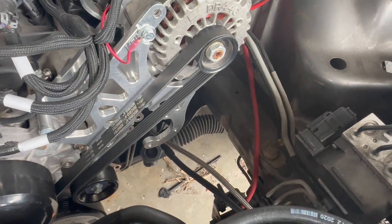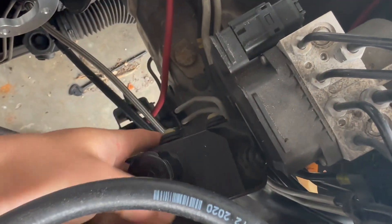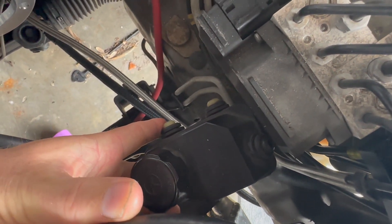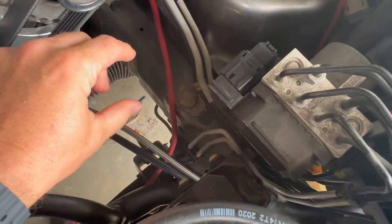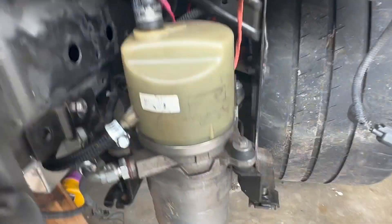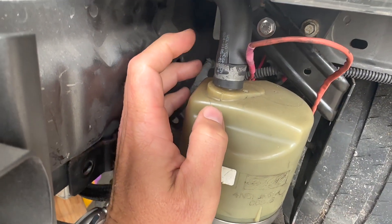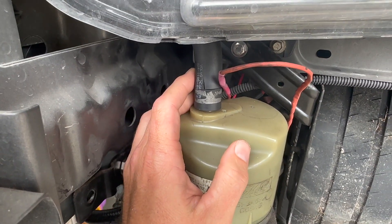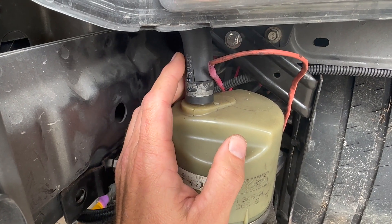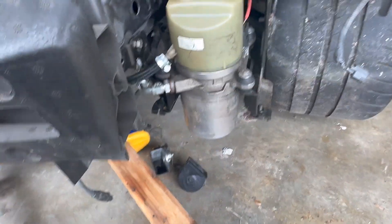As far as the Volvo power steering pump you should use — there are two of them. There's a remote reservoir version, which I ran, and there's one that has a cap directly on top where you fill it directly. The problem with the direct-fill cap version is that in this location — which I feel is the best location after trying it everywhere — you won't be able to fill or refill it. So get the remote reservoir version.